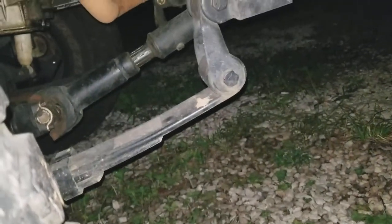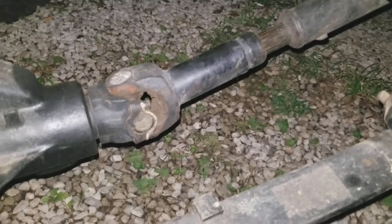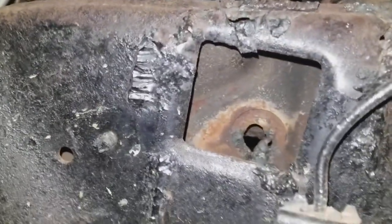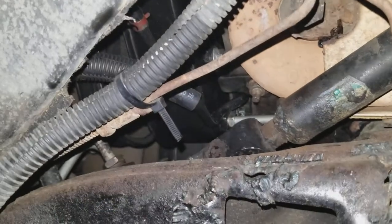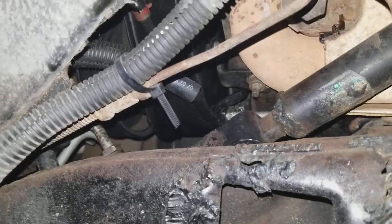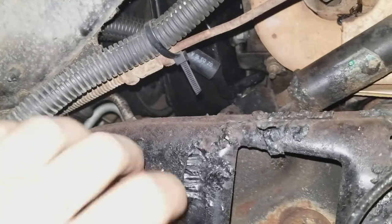Running Chevy shackles out of like a K10. The front driveshaft is a TJ driveshaft. As you can see, with the steering box, they're all factory GM parts, factory Jeep parts, or factory parts - easily found at a parts store. The box is out of an OBS 3500, I believe the years are '89 to '99 Chevy 3500.